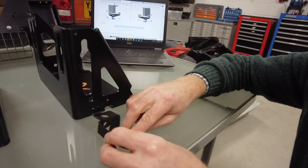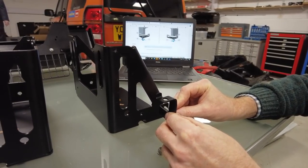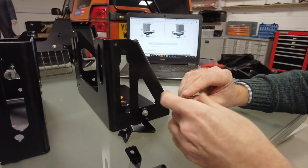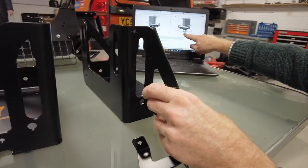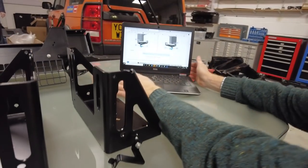There's a little bracket that needs to hang down below, but we don't need it because we've got the aluminium undertray with the mounting points. I'll show you what it is and put the parts to one side. If you needed to use it, you grab these two little brackets — again these are handed but not labelled. The bolt goes from the bottom up through the hole, with the nut on top.